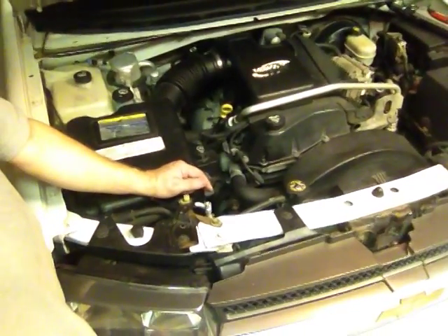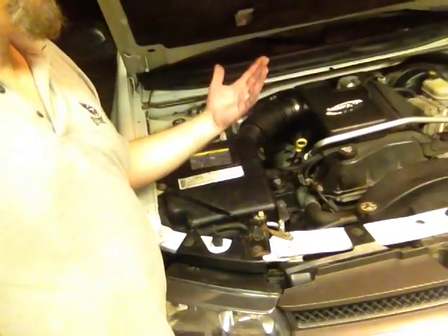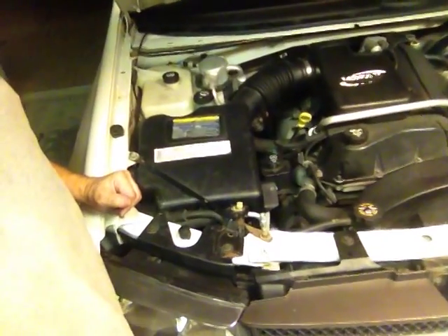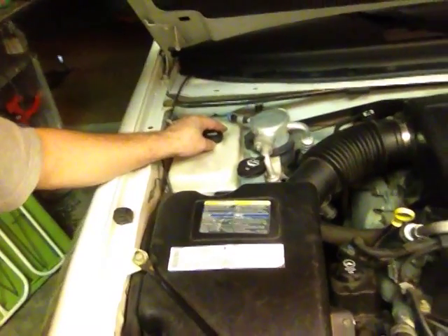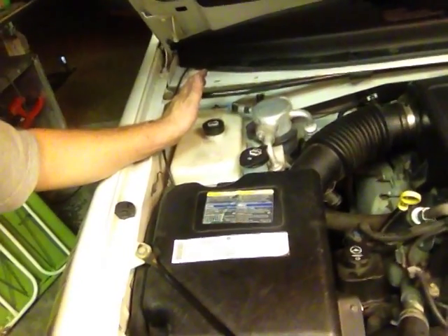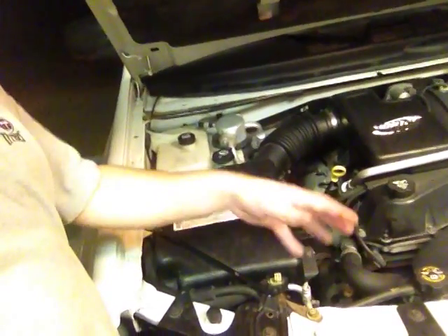Also, if you suspect your car is overheating because of the radiator fluid, you don't want to open it when it's hot, and you also don't want to put room temperature or cool coolant or even water in there. Some people fill it up in the overflow to get it soaked back in, but if you put cool water or room temperature water — even like 90 degree water — or coolant into a hot engine, it's going to seep back in and it's definitely going to crack your block and blow your engine.